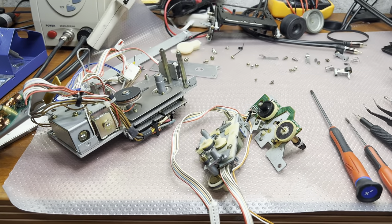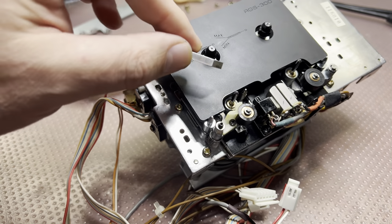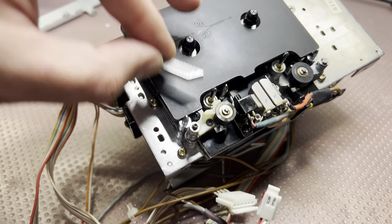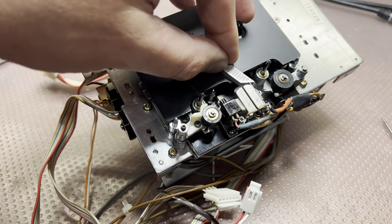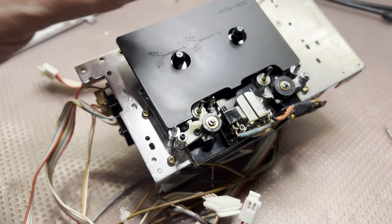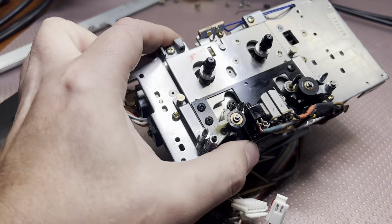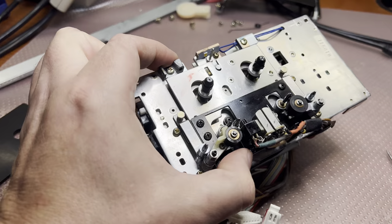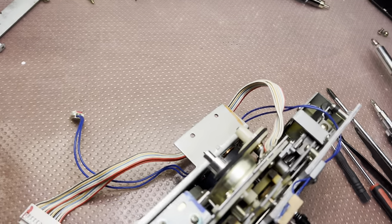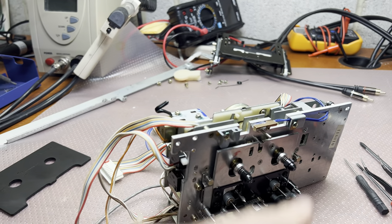Let me assemble. I've spent quite a few hours on this - I got the tools to get into the small hexagon screws. I'm tuning the height of the guide and the head - I have to push it up and check that it goes smoothly in all positions. The same applies to this guide. Everything is now lubricated and goes much smoother - both pinch roller arms and the carriage. I've already assembled this part with new idlers and belts.